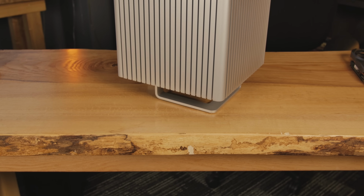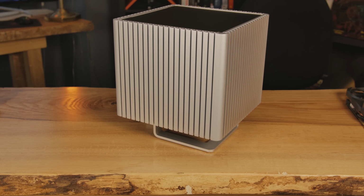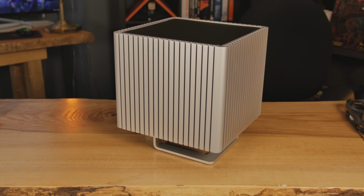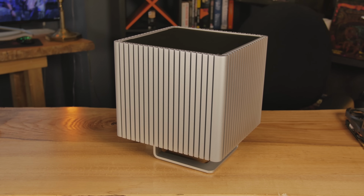Okay, in all fairness, we totally could have run this thing a lot faster if we'd had just a regular i7 on an 1151 board, but we kind of went with the Ridiculosity theme, went with X99, and it actually kind of worked out. Streacom does, in fact, on their website have a multi-panel kit that connects the heatsink to 2 side panels. It's a 105 watt kit versus the 65 watt kit that we ran, and would probably be a better idea for somebody who wanted to run an i7 7700 or even a higher wattage i5. It will run an i5 on the standard heatsink, but you know, maybe a little upgrade would be needed.